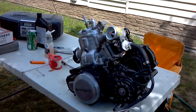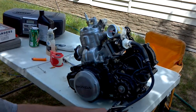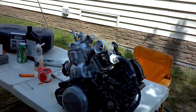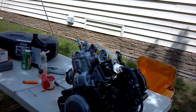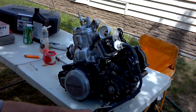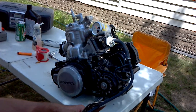I'm going to show you how to use this leak down tester. I loosened a nut up on my intake manifold for my carb to cause a small leak, so that way I can show you what it looks like. You just barely got to put pressure in here just to get it up to 7 psi.